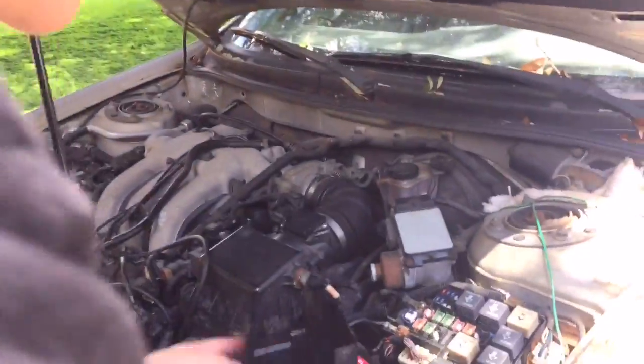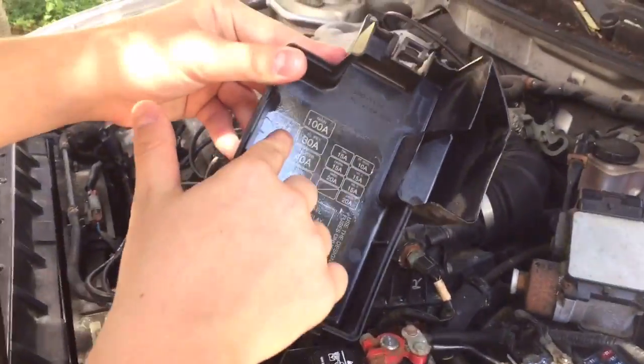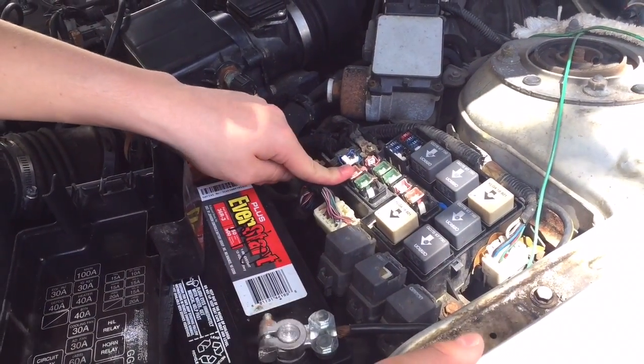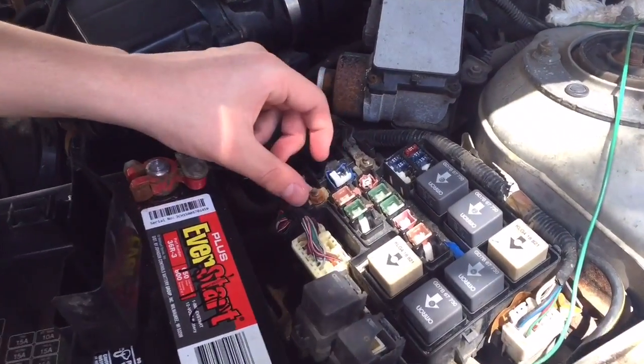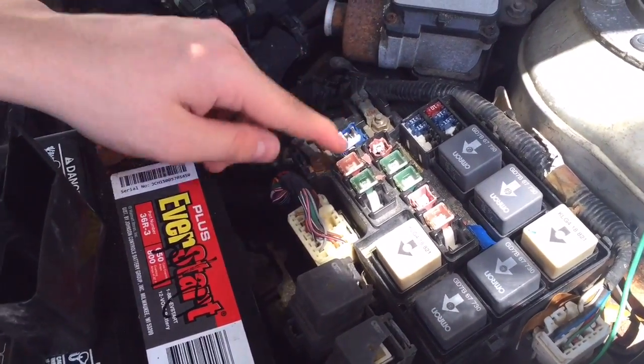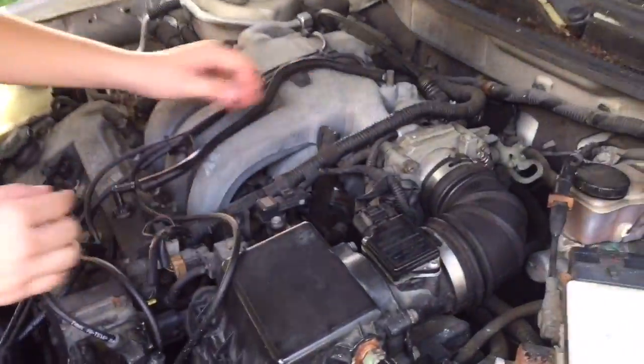Also, this car has an EGI injection system — which is the fuel injection system and the fuel pump. There is a pink fuse for it right here. If that fuse is split, you want to replace that before replacing your fuel pump. So check the fuses and relays, spray some starter fluid into the throttle body or a vacuum hose, and if the relays are good and the car starts on starter fluid but you don't hear the fuel pump prime, you can be pretty certain it's your fuel pump.